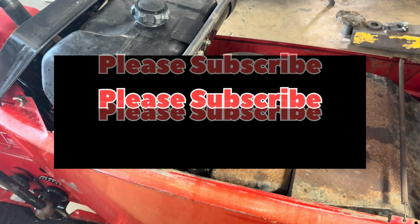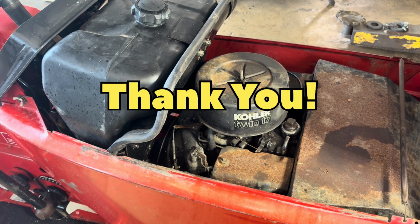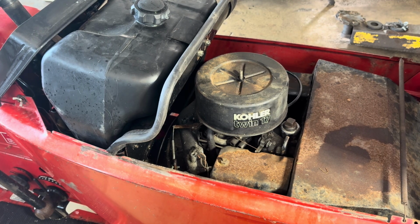On these Kohlers with a KT17, you definitely want to have the oil changed quite often in them. They are quite an issue, especially if you're working on side hills. So make sure the oil is always full, maybe even a little bit more than full.